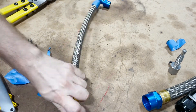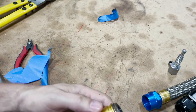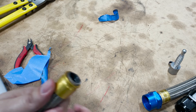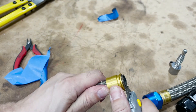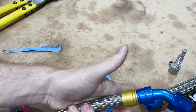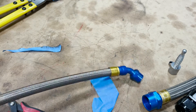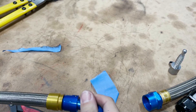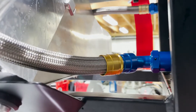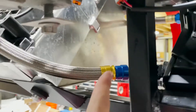Take your fitting — which is still on the car — pull this forward until it's flush with the stainless sleeve, and you'll see how much needs to be cut off. Take your knife and cut that off. Once you get it flat, slide the fitting in — and that's it. That'll be your hose. Put it back on the car, test fit it, and make sure everything's good before you mail it off. I've got my 90 that we just made, and that goes up over the steering rack, down over to a 45 into the passenger side oil cooler — the feed line for the system. Hose is done. I'll tape it and mail it off to BMRS with the four other hoses.